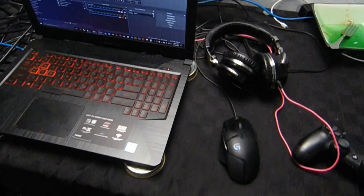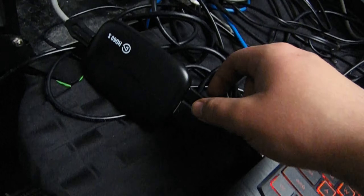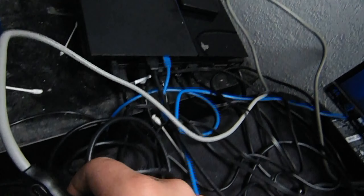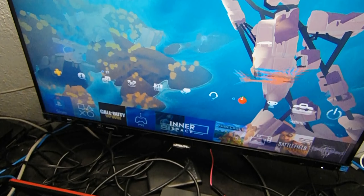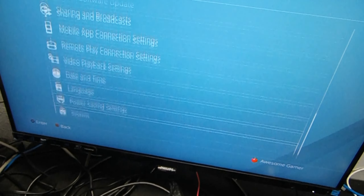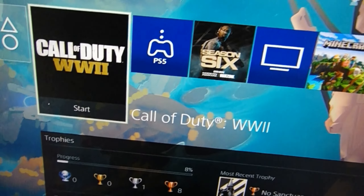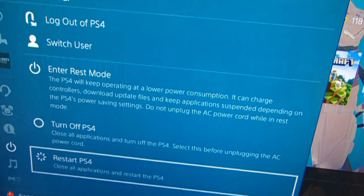All right, I'm going to show you how to install the Elgato. You take the HDMI from your Elgato box and put it into the HDMI in port, and you need another HDMI that connects to your monitor — which I'm already connected to right now. Before downloading the software, you need to go to your PS4, go to Settings, then System, scroll down and disable HDCP. After that, restart your PS4 by going to Power and then Restart.